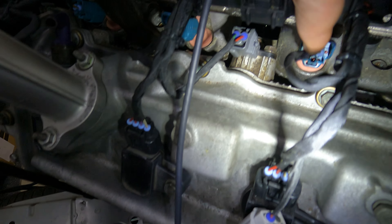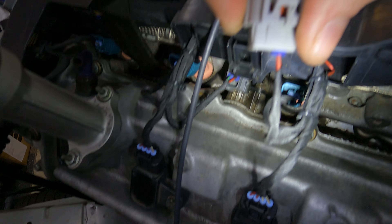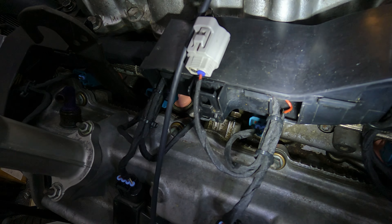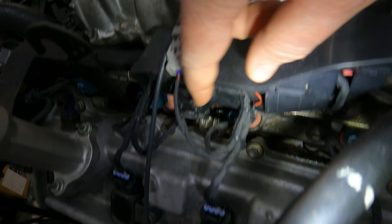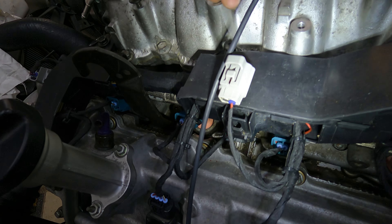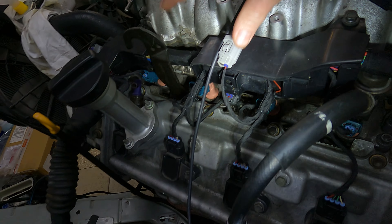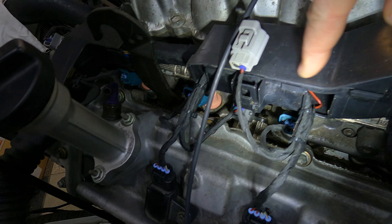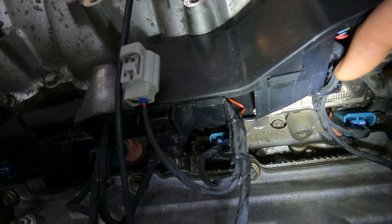You've got injector five, coil five, and a little plug that goes into a suppressor that bolts on the engine itself. We've removed the EVAP — there was a little solenoid there that can be got rid of. We've remapped it out of the ECU, so there's no EVAP at all. Coming further along to here, there's another breakout coming out the back for coil seven and injector seven.